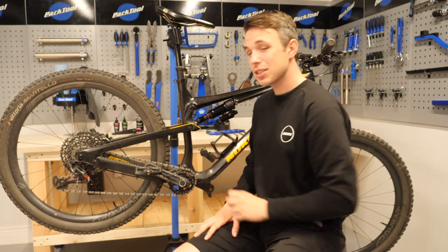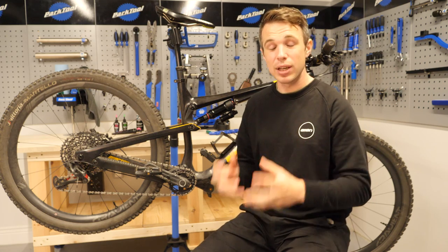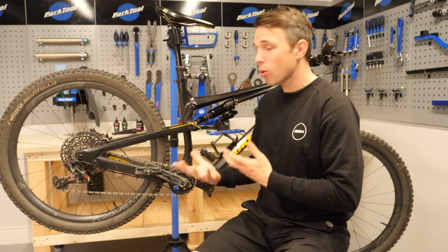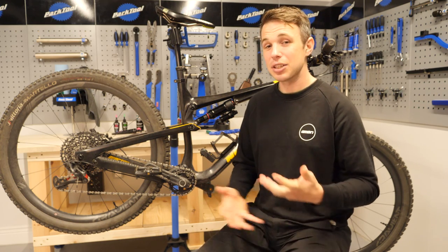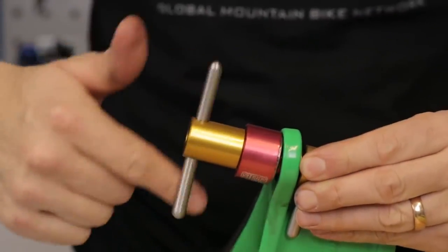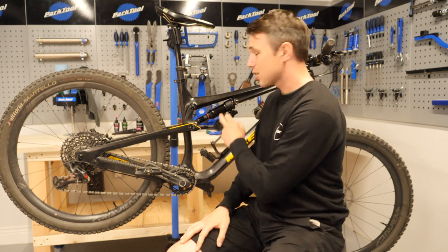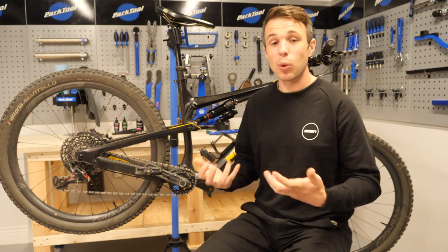The last part to talk about is the linkage systems on our full suspension bikes. All the hardware and pivots will do their best work if they are cleaned, re-greased, and torqued to spec. It can often be tempting to try and eke extra life out of worn components and bearings, but in my experience it just isn't worth it — a bearing or bush is either good or it's not. Trying to extend the life often doesn't go to plan and just means your bike fails out in the middle of nowhere, as opposed to popping some new bearings in. If you do want to extend the life of your bearings as far as possible, remember that some of these bearings have quite a limited range of movement, especially in the mid-stroke. Just disconnect your shock and cycle the whole linkage through its travel — this will make sure all the bearings get into some grease, stay lubricated, and will in turn last longer.